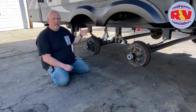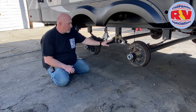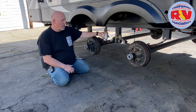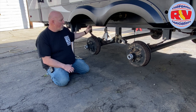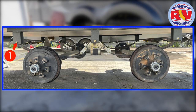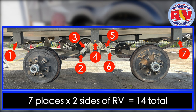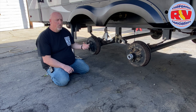That's why we're recommending the Roadmaster kit. The benefits of having the Roadmaster kit: we're going to remove the equalizer, remove the shackle links, remove the standard springs — all of this stuff goes away. Currently, this unit has seven points of wear on just one side — one, two, three, four, five, six, and seven places that this suspension can be subject to wear, fatigue, and damage.